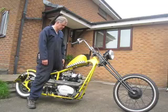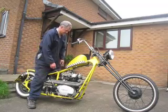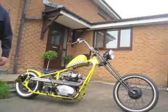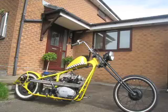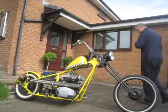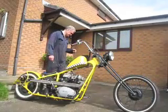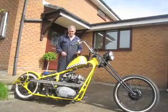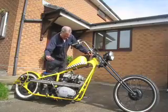One cylinder. I'm going to put my old spark plugs back in, see what happens. Let's try again. Set the timing a little bit. Well, it's more towards the F. Let's see what we can do. Just put the fuel on. Yeah, it's on. Switch is on.